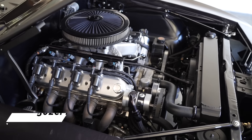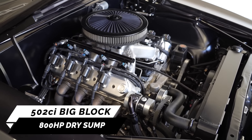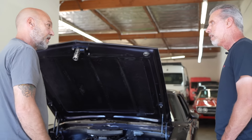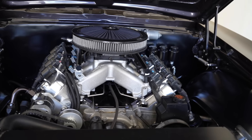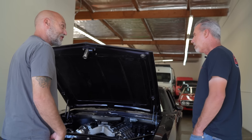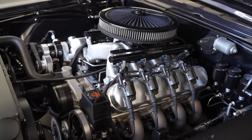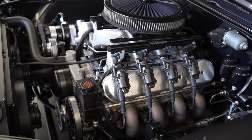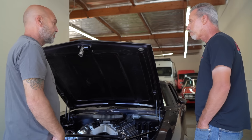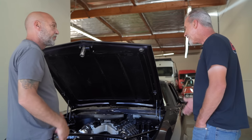What are we looking at here? A lot of people think it's LS7 because it says LS7 on the handle — I know that's why Jason said you have a dry sump LS7 — but it's actually an RHS block. It's a tall deck 502. You don't see that very often. Everybody's got LS, basic LS, LS7, LS3. I wanted something different. So what kind of power do you make? It made 800 on the engine dyno. It is dry sump. Why did you dry sump? Originally built it for road course and autocross stuff. So you actually want to go drive this car.